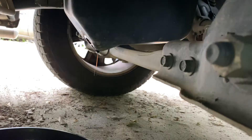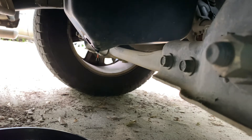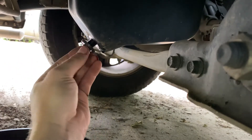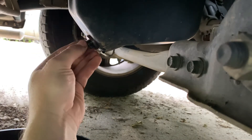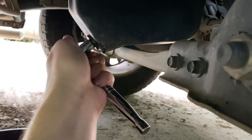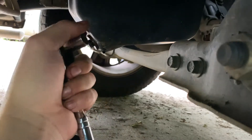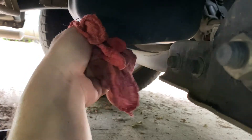All right, the blinker's good as new. Now all the oil has drained, we're going to wipe it off and go ahead and get our drain bolt put back in there. Give it a little snug — it doesn't have to be super tight, just a little tighten. Don't want to damage anything. Now that it's all tightened up, clean it off so you can check for leaks later.